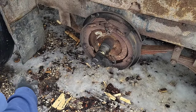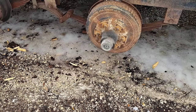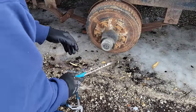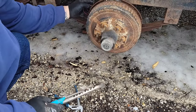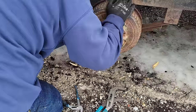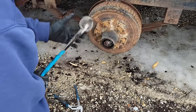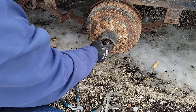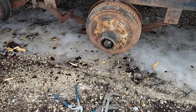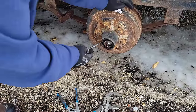If I just gotta tear these down and clean them up, that's what I'm gonna do. Let's move to this axle - I already took the nuts off. I want to see what I got, and that way moving forward I'm probably gonna put four brand new tires on this thing. These brakes look like they're hooked up - you can see there's pigtails here and they are attached. The wiring for these brakes goes through the axles - these are 5,200-pound Dexters. This grease is a little redder than the other stuff, and again this nut's loose. That other bearing got hot because it was over-torqued, which is something you definitely don't want to do with trailer bearings.